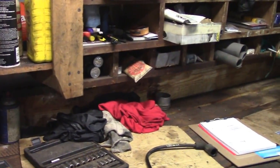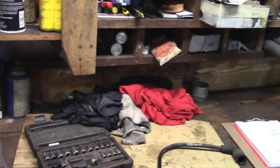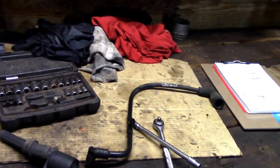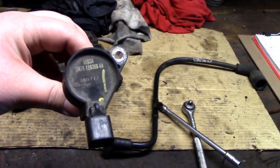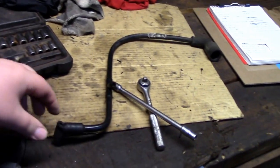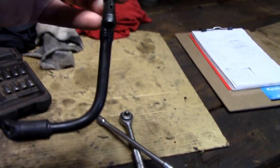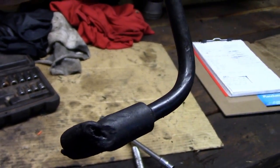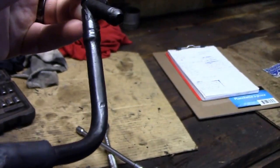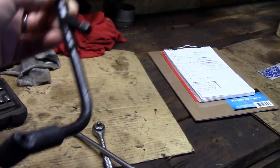Generally with Fords you want to replace all the coil packs and just be done with it, unless you want to do this every six months. Here's the original Ford coil pack that was on it. He also found this vacuum line setup that is worn straight through and melted a little bit, so we're going to fix that up too.